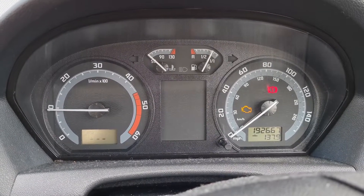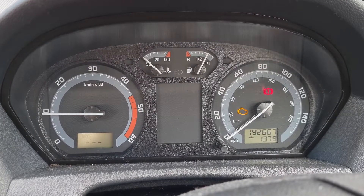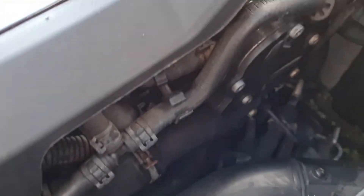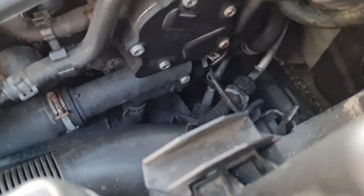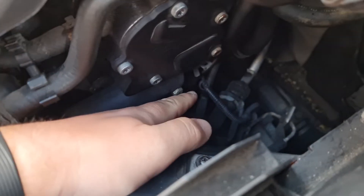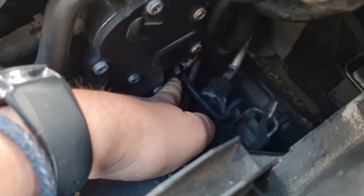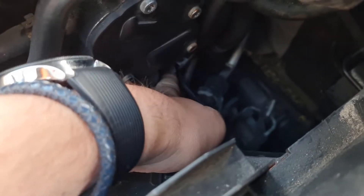So I'll go ahead and change this temperature sensor, which I hope is easy to get to. We'll soon find out. This is going to be very difficult to film. It'd probably be easier if I took the airbox out, but that's not going to happen. So this is the cable, and it comes in the back here - the coolant temperature sensor sits in here.